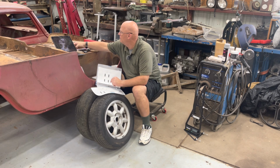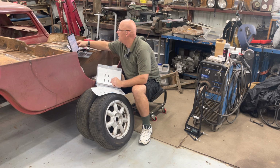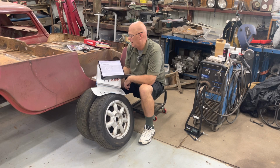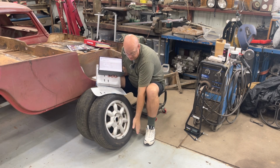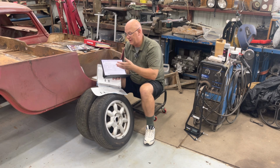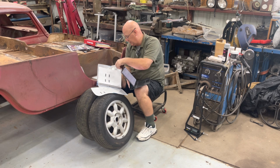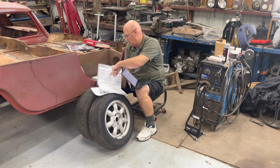So I found online, make sure this thing recognizes me. There, it recognized me. A website called WiseFab, WISEFAB.com. WiseFab sells toe plates, as in a piece of metal or aluminum that goes against this side of the tire, and the other side of the car, you do that, you put tape measures between them. That's what they sell. They don't sponsor me. I've not bought anything from them. I just found their website because on their website, like for the Porsche, it said I'm supposed to be at toe 5 minutes.